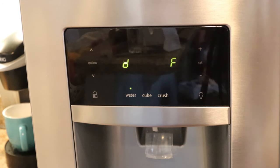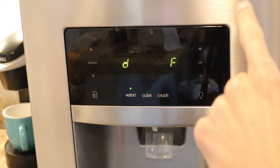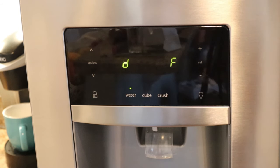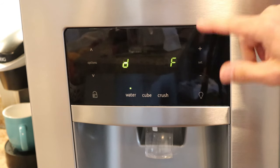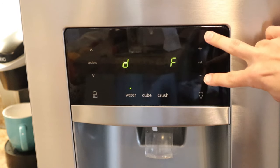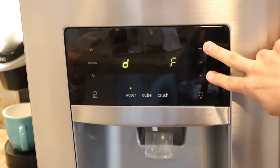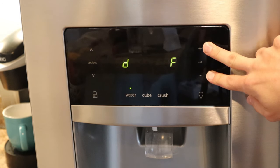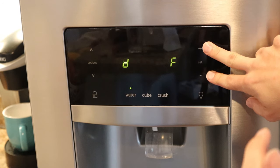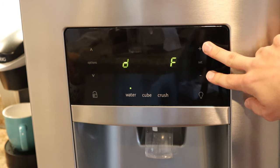What I'm doing — I am going to use the blow dryer. However, your refrigerator has a built-in defrost on it, and nobody's going to tell you that it's there except for us guys on YouTube. All you need to do to put your freezer system into defrost mode is to hold down the plus and minus until DF shows up on the screen where the normal temperatures would be. Keep in mind when you put this into defrost mode, the compressors are going to turn off for the freezer and refrigerator and it's going to put it into defrost mode. So you don't want to keep this on defrost too much because everything in your refrigerator eventually will defrost.